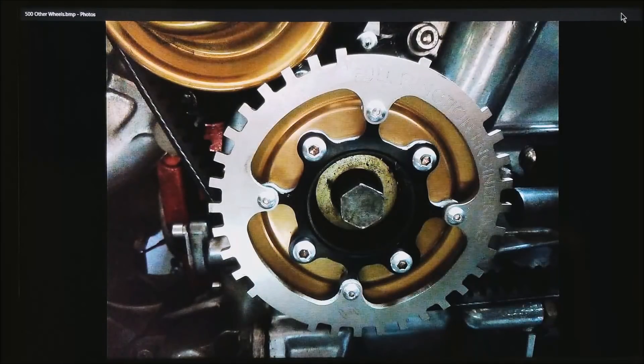This happens to be the front of a Subaru. What we have is — you probably would have had 36 teeth — but there are missing teeth at two locations. The point is some ECUs can deal with these fairly creative tooth patterns and others cannot. Make sure you plan ahead that your ECU can accommodate the tooth wheel you have chosen.